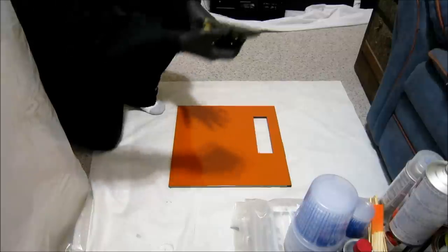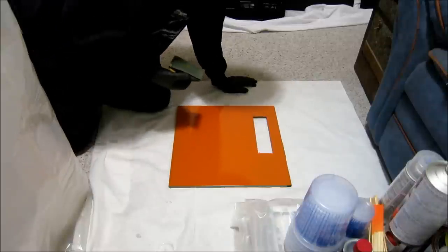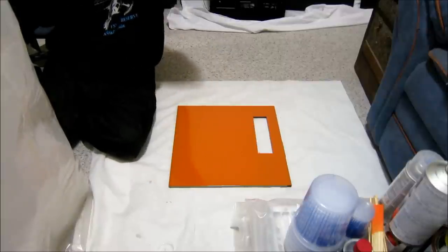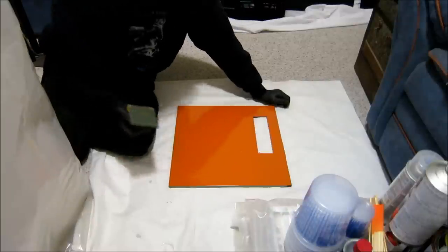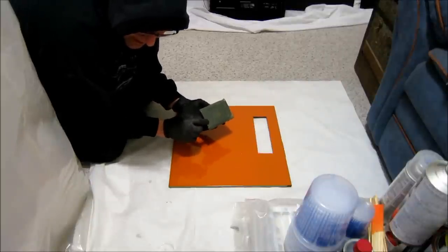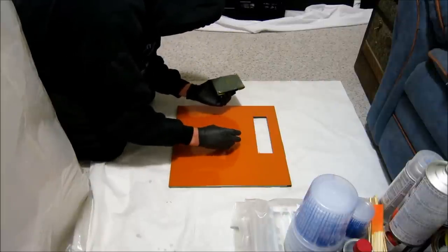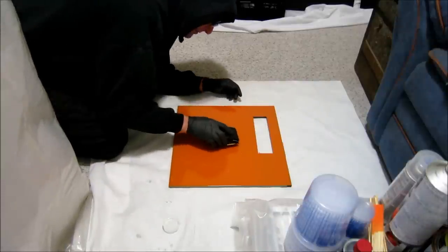All right, paint freaks, case modders. Yesterday I wound up with the last of the color coat on it. And now we're actually going to cover a little bit of wet sanding, because I have a couple of little fuzzies in it. I'm just going to demonstrate the use of 2000 grit wet sandpaper, my block, a little bit of water. So a nice flat surface again. Just keep the area a little wet, and we'll go to town with a little bit of sanding.